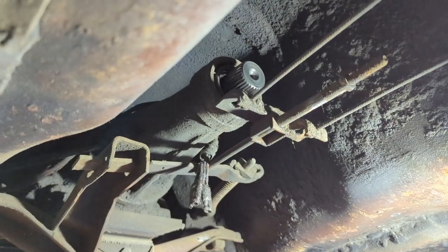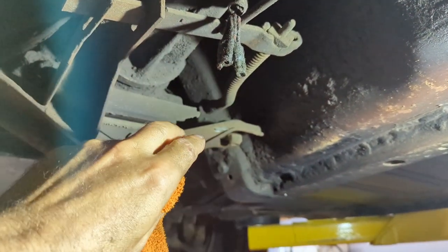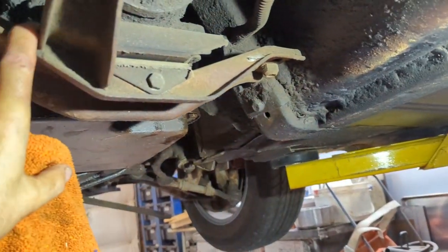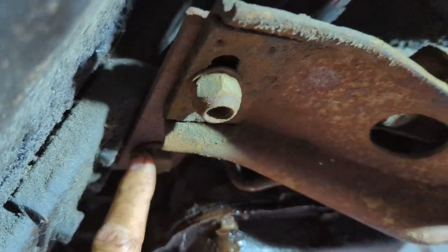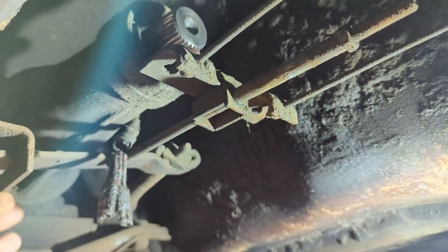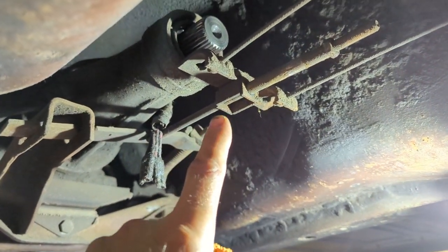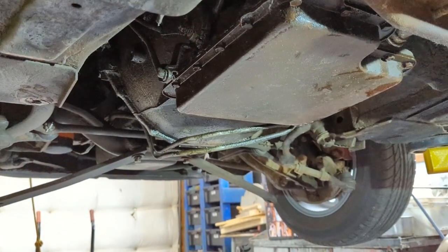With the driveshaft out, I need to get rid of the park brake cable. I'm going to spin a wire brush to clean up the threads and spin the nut off. The park brake cable on these cars is incorporated in the transmission mount, so that'll all come off with the mount. This is the right mount — for the C6 they just made an extension, but didn't ruin it. This will all have to be taken apart to readjust the park brake. Then I'll go out front and take the torque converter inspection plate off and get the torque converter nuts off.